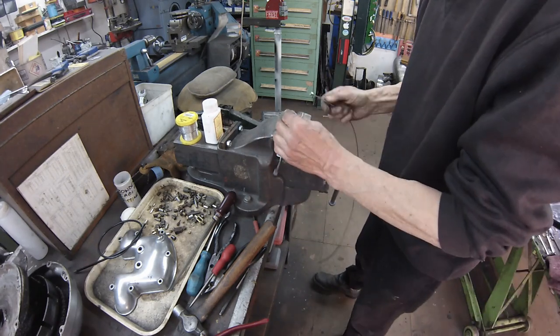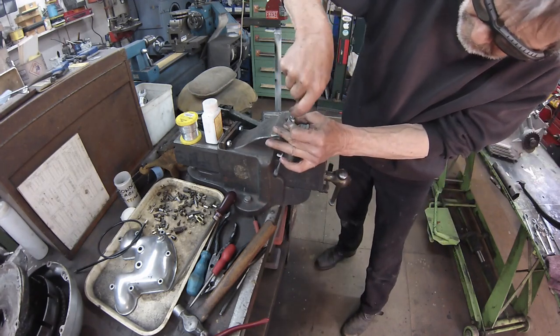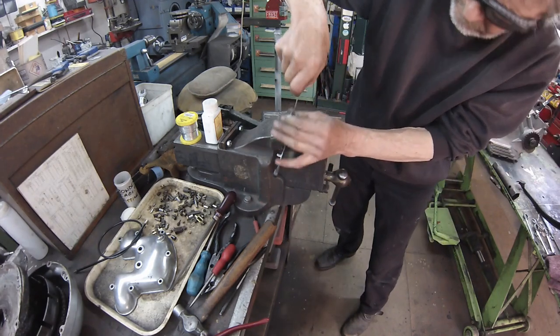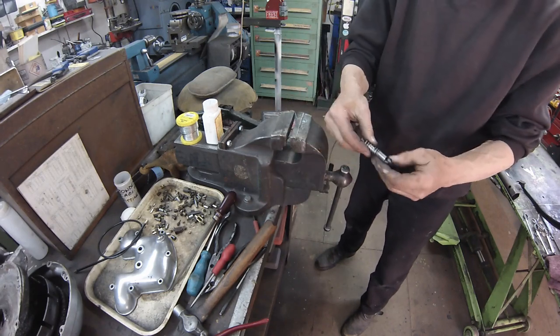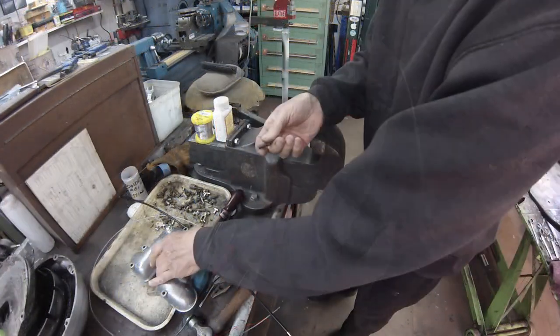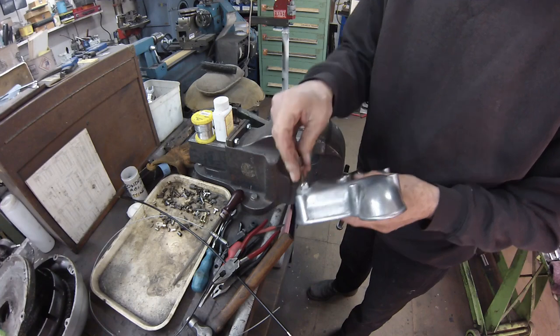Assembling as I go helps avoid backtracks, because the sweet spot between an inner too short and too long is surprisingly tight. With the operating lever assembled, set the adjuster about halfway and slip the outer cable over.